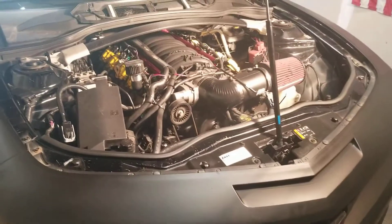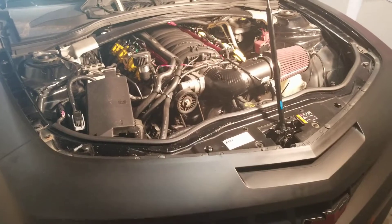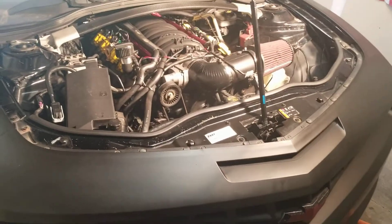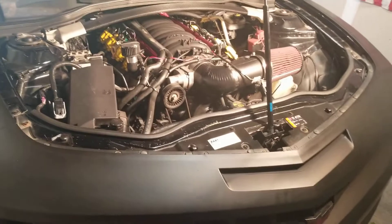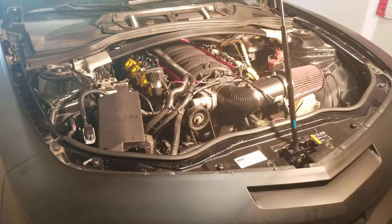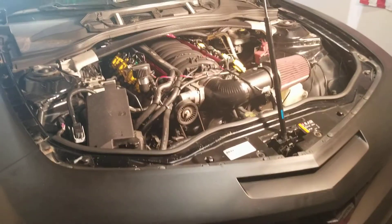The answer is actually quite simple. The Holley Hi-Ram is extremely high and extremely big — it's better suited for cars that have boost, such as a turbo, twin turbo, or a sequential supercharger. On a naturally aspirated engine, when we had the Holley Hi-Ram intake, we lost 10 horsepower and 50 pounds of torque, which was not what I was aiming for.